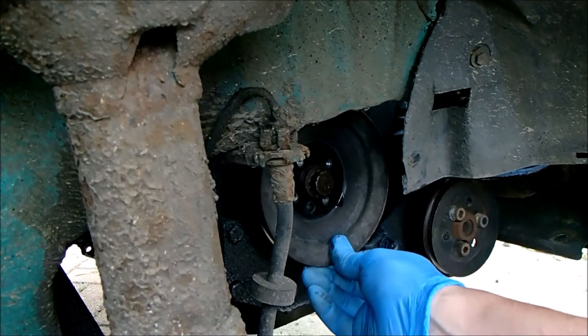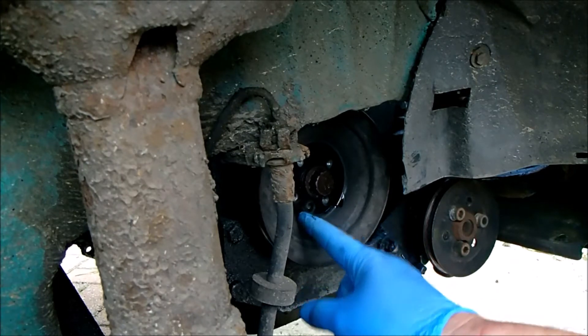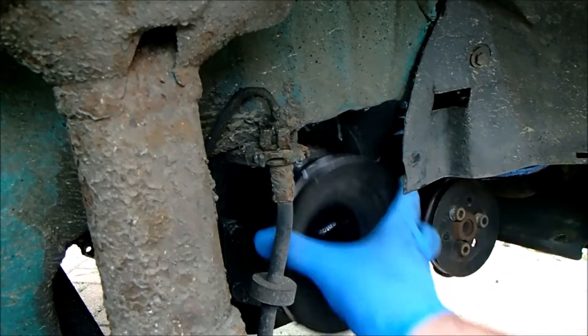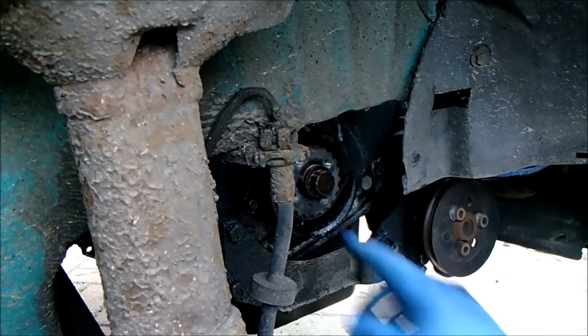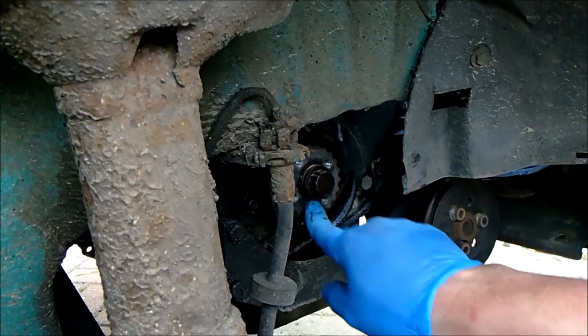This is loose as well. Both pulleys are indexed using a pin just on the crank pulley. That pin almost looks like it's been sheared, but I guess it just indexes where the pulleys go — it doesn't actually drive it. So that's okay.